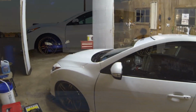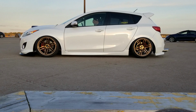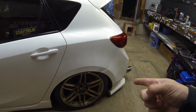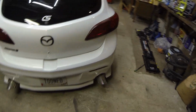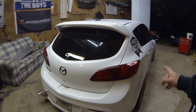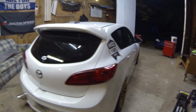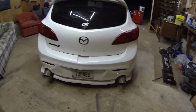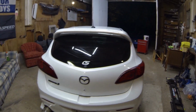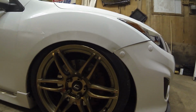Like I said, the car's on air suspension. It's all on Airlift struts in the front, struts and bags. The rear is Koni yellow shocks, and universal airbags for the rear. I bought this kit all separate. It wasn't all one kit from Airlift, so I kind of had to play around and figure out what fit. And I've got custom control arms from Dominant Engineering in the rear, and also I think it's SPC adjustable camber arms. I run like, I think it's a -2.5 in the rear and -2 in the front maybe, so nothing crazy. Moving on to wheels, tires, and brakes.